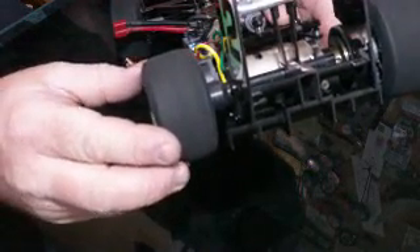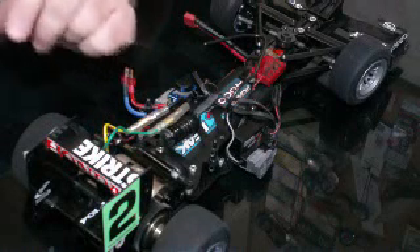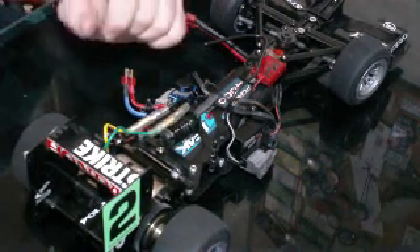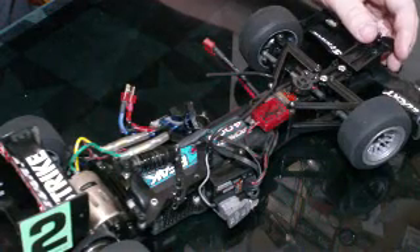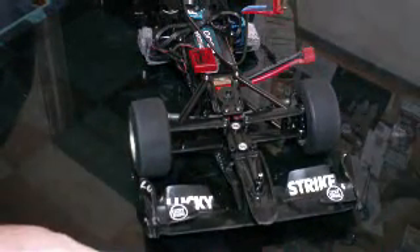The tires look pretty good. There's not a ton of damage — they're not really ripped up, the feathering looks nice, they're not really grained badly. The tires I was using earlier were grained pretty badly, coming off after just one run. These look much better by comparison. The fronts I was able to run multiple times, and that seemed to balance the car the way I wanted.